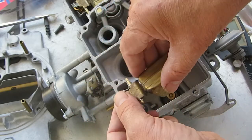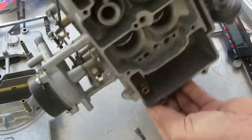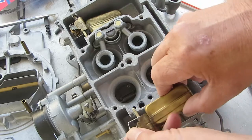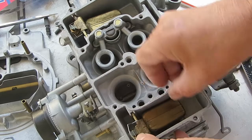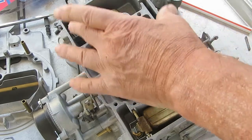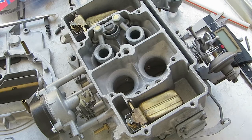Don't try to fudge it. If your carburetor is flooding, it's probably not the float — the float is usually the last thing that is the problem when you're talking about flooding. If it's flooding, setting the float to another quarter inch isn't going to give it less fuel; it just ain't gonna work. So we put this back in, clip it over — we bent it a little so we remeasure it. On this one, the secondary is the same depth — same float level on both primary and secondary. That's how you set the float level on a 4100. Thank you for watching.